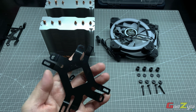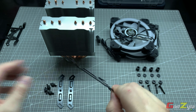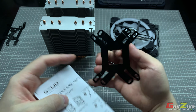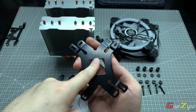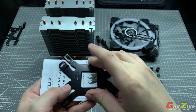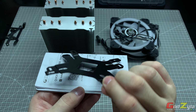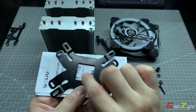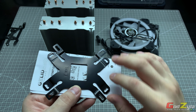Looking at the back plate itself, you can see there's Intel wording over here, there's AMD wording over here. Assuming this is your motherboard, the back of it, the rear, face whatever processor that you are using. Let's say you are using the Intel, face the wording Intel inside, showing the AMD outside. So this is how you should be mounting on the Intel itself. Else for AMD, just turn it over with the rear itself, showing you the Intel wording. Probably you'll get confused right now, but I'll show you later when I mount on the AMD itself.